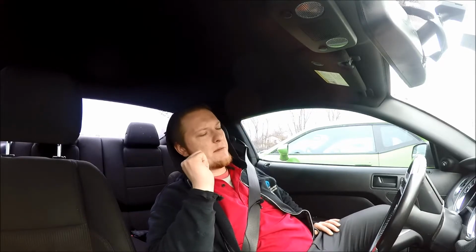And you have to do this while you have the clutch pushed all the way down to the floor. If you do that, you're going to pop that spring out, and now that's your clutch spring delete. Some people didn't like the feel. They said they had a loose clutch, like it could kind of move a little bit and it wasn't doing anything. Mine had absolutely no play in it whatsoever after I got done with it, and it did nothing but make it feel 100 times better.